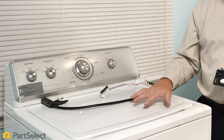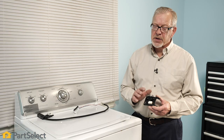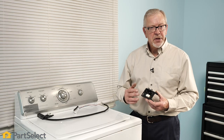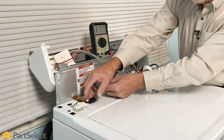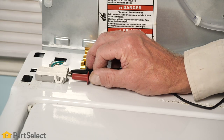One of the first things that we might suspect to cause a top-load washer to not spin will be the lid switch. Depending on the model, some washers will actually fill and perhaps agitate even though they have a defective lid switch — although that is not normally the case. In the case where the lid switch fails, the washer will definitely not spin. It's easy to check a lid switch using a multimeter: disconnect power to the washer, identify where the switch is located, disconnect the leads to it, and test it with a multimeter.